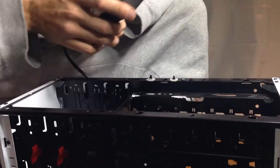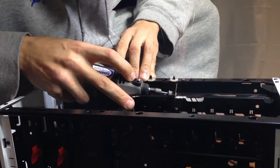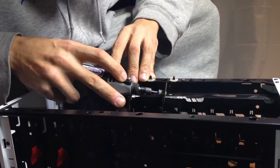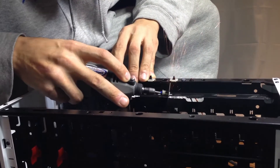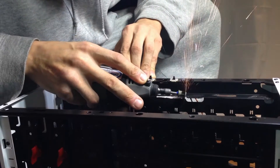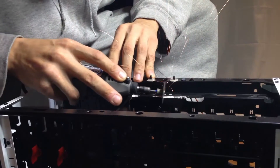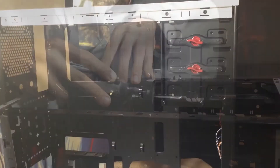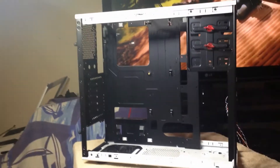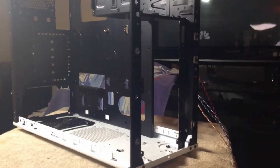The next thing was to cut out the drive base and see if I could fit a 240 rad in the front. I've done this with my Reanimation build on two Antecs — on the Antec 900 you could put a 360 in the front. This case is a lot smaller, and it turned out I was only able to fit a 140, so I decided to go with a thick 140mm radiator in push-pull config, which is more than sufficient for CPU cooling. Once I had the front drive cages out, it seriously opened up the case — I'm not sure why every company feels the need to line half the case with eight to ten drive bays.